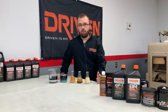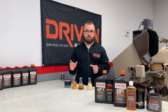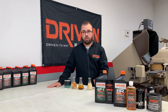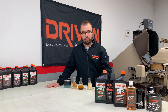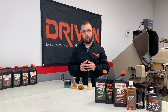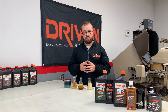We're going to get into that today, but before we do, I want to talk about the purpose of the engine break-in period and why it's important to have a fully formulated break-in oil instead of just a zinc additive on top of your off-the-shelf engine oil. The purpose of the engine break-in period is that it is essentially the last machining process of the engine build. With any freshly machined part, you're going to have peaks and valleys. These peaks and valleys are called asperities. The break-in oil chemistry — a fully formulated break-in oil like you see here with the Break-In 30 or the BR-1550 — helps to chemically assist those parts to mate together, whether you're talking about cam and lifters or a piston ring to cylinder wall, to create good surface area for the longevity of those parts so you have a good long engine life.